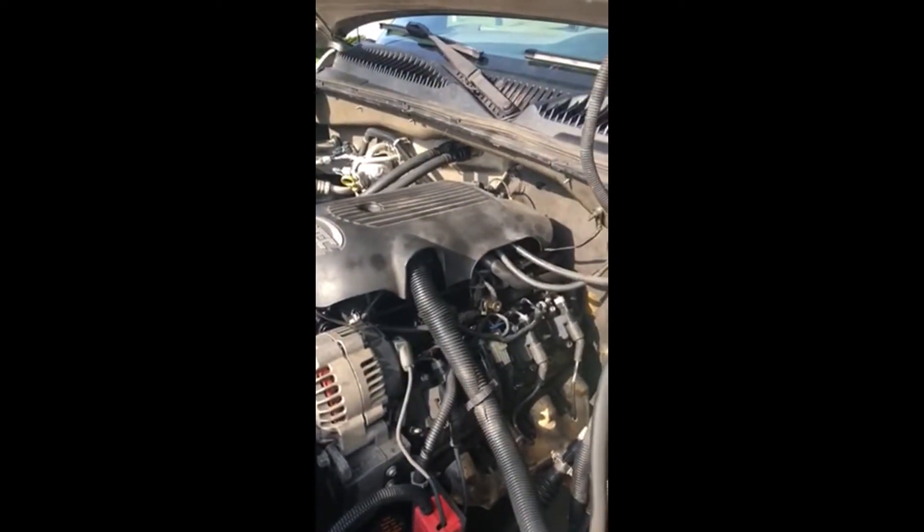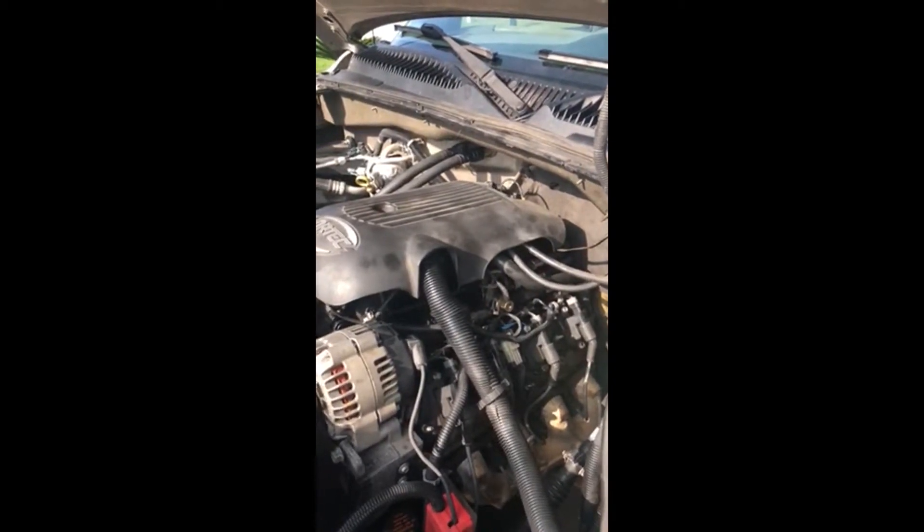I found out to keep this from reoccurring, even after you put in new knock sensors and wire harness, is start the vehicle up, rev it to 5,000 RPM, hold it for three to five seconds, two times, and then those codes do not come back and reappear.